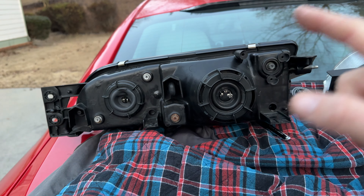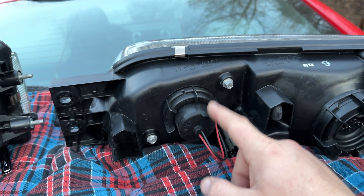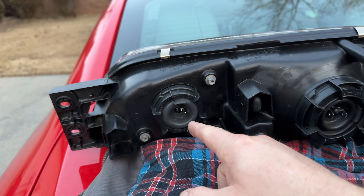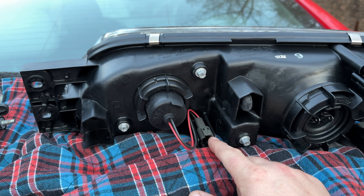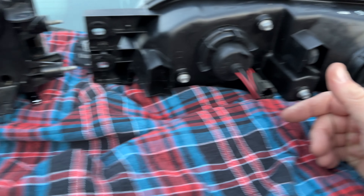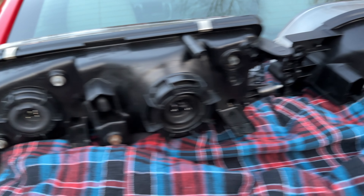What I want to point out is this bright light — this was the same problem I had with the UK set. They must use a different bulb for the European market. What I did previously was take the bright light from my Japanese Silvia headlight and swap it in to match my connectors. I've also seen people chop the connector off the harness and put on one that matches the European plug — I don't know which bulb is better, but that could be a future investigation.